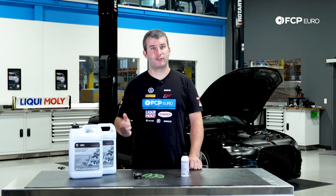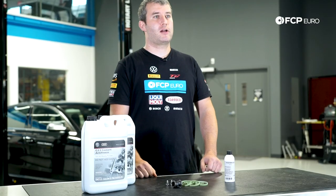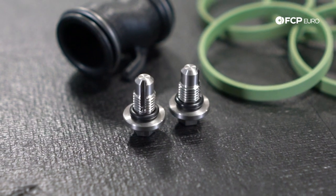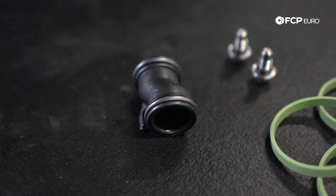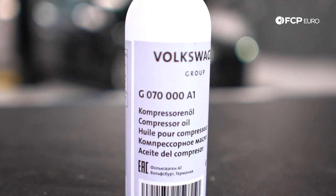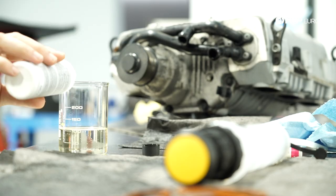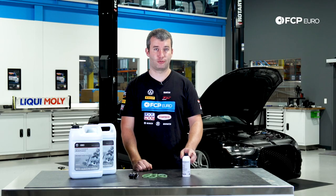So A6s, A8s, Q7s, Q5s — the list goes on. Parts required: you're going to need some coolant on hand to refill the cooling system because you are going to drain a little bit. Pictured here we have the 034 Motorsports bleeder screws, the PCV vent hose, supercharger gaskets, and the supercharger oil. While the supercharger is off it is a great idea to change your supercharger oil — there is no service interval, and especially if you're single pulley or dual pulley, it is definitely a great idea.